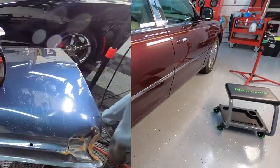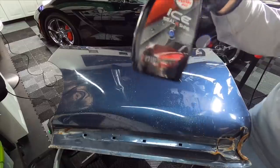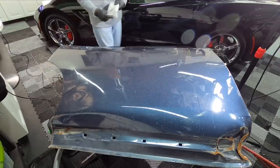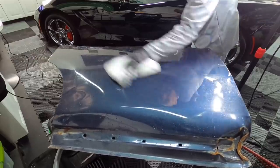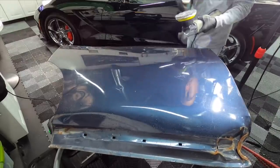I want to show you how effective it is with a short demonstration. We're going to use Seal and Shine — we all know this is a benchmark and it's very tenacious. We're not going to remove an old or aged wax; we're going to remove fresh Seal and Shine and show how difficult that is, as I've demonstrated in many videos. So proper preparation of the panel — I'm never going to skip that. We're going to clean it, quick polish it, and use an IPA solution.